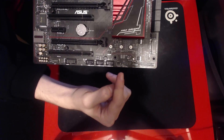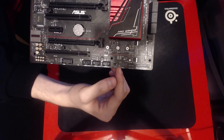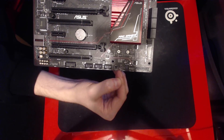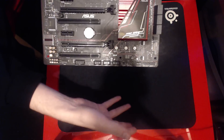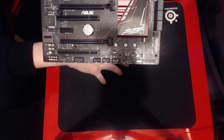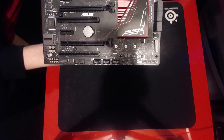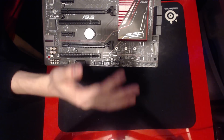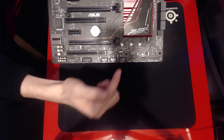Next to that you get the OCJ — that's a little overclock connector. It gives you a pinout for safe boot, retry, and slow mode. Safe boot is basically for if you screw up your BIOS and the motherboard won't post. You press the safe boot button, it sets all the motherboard settings back to default — default CPU speed, default RAM speed — so it'll start up. However, it'll retain all of your BIOS settings, so whatever dodgy memory timings you put in are going to still be there after you press the safe boot button.